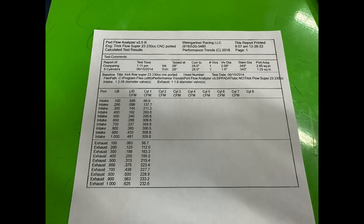The 0.400 number is outstanding, the 0.500 is outstanding, but after that it's just meh. That doesn't mean it'll be a dog — the 0.400 number will help it a lot. On the exhaust side, flowed without an exhaust pipe, it does 195 CFM at 0.400 — really good — 223 at 0.600, and peaks at 233. Pretty good there, especially considering this isn't a super highly-raised exhaust port. Overall a really good head that should make plenty of power.